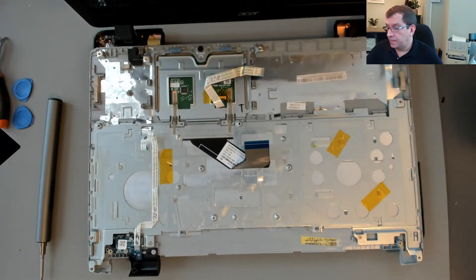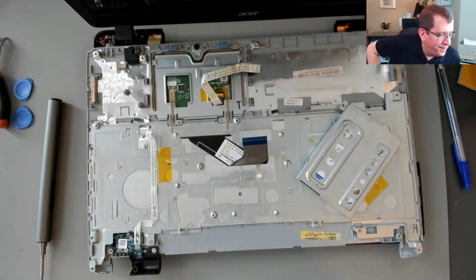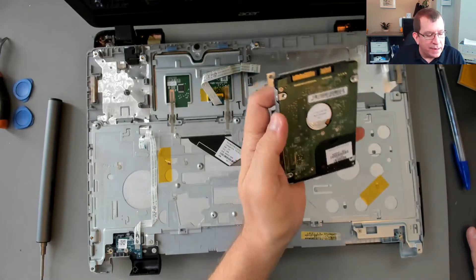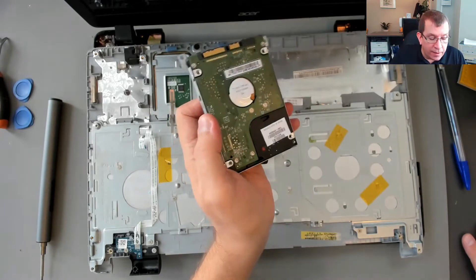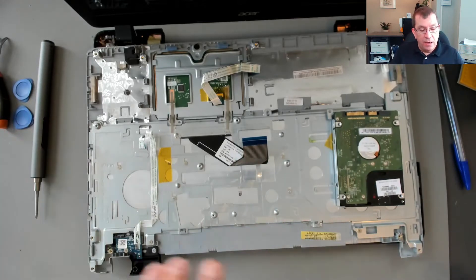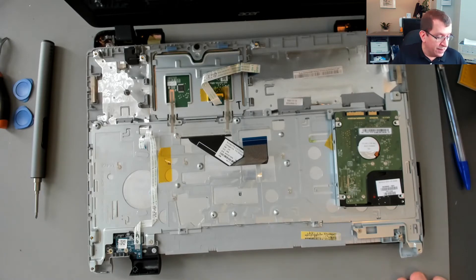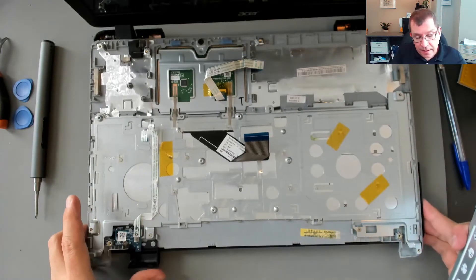Doesn't sound good. I spoke to the customer and explained that this hard drive is dead — I can't read any data from it. When I plug it in it just clicks, so there's an actual problem with it. I offered my different solid state drive pricing and he doesn't care, he just wants it up and running at the cheapest price. So we'll put a 250 gig SSD in here and install Windows. He confirmed I have a 90-day guarantee and said if anything goes wrong he'll be bringing it back. I said I expect nothing less, and hopefully that's all that's wrong.